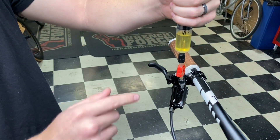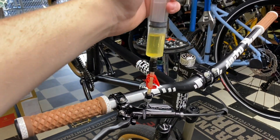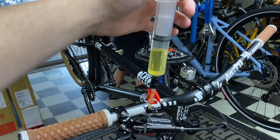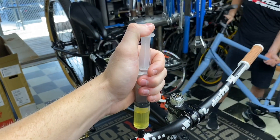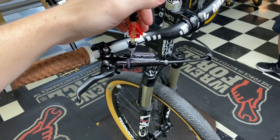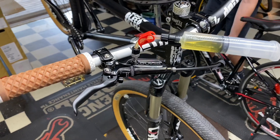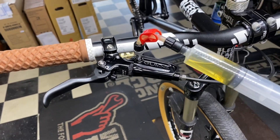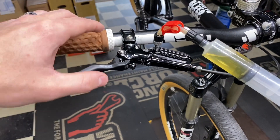It's all the way up there — we're good to go. Don't pull too much on this plunger because you can break the seal — just go back and forth on it. My last thing is I'm going to push down one last time just to get a little pushback so I'm pressurizing the system. It's pressurized — we're going to go ahead and clip this off. Don't do this if you want to do a solid bleed because I'm basically pushing new fluid in with old fluid.